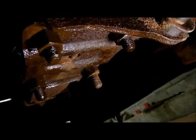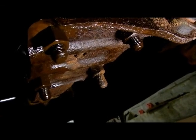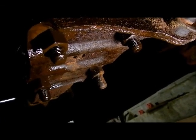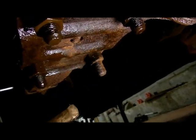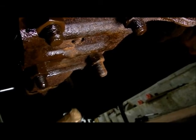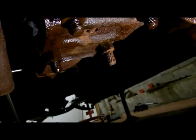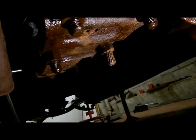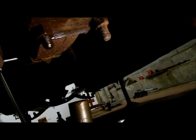We're going to remove the three-quarter inch nuts that are on the U-bolts. First thing you want to do is take your wire brush and get the debris off of the threads. Then you can start with your wrench, impact wrench, socket or whatever.